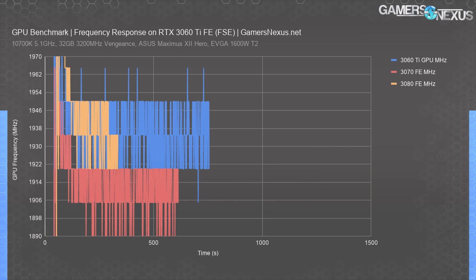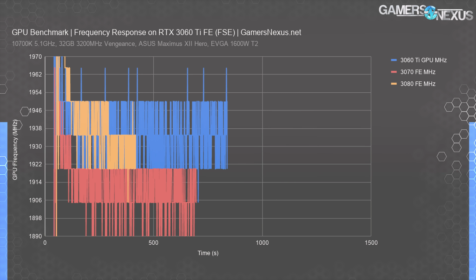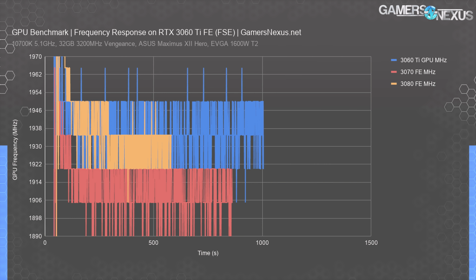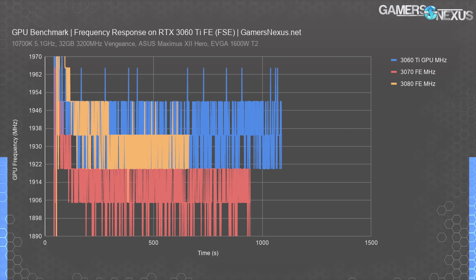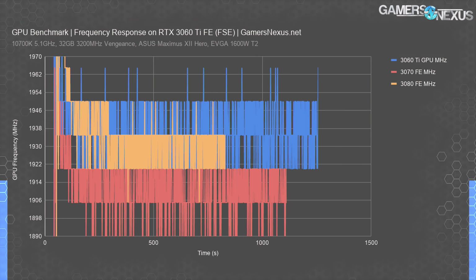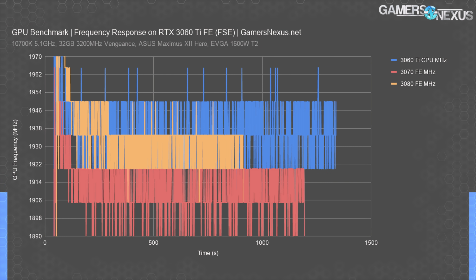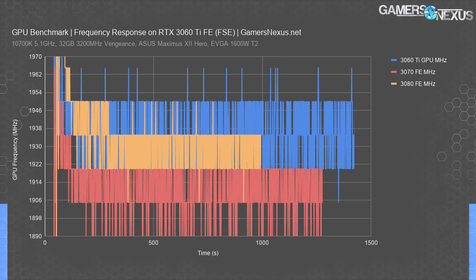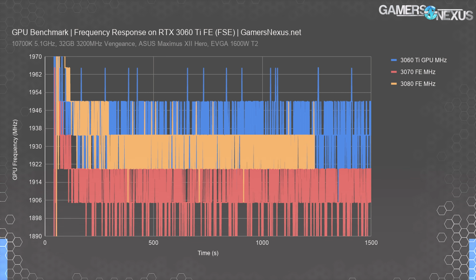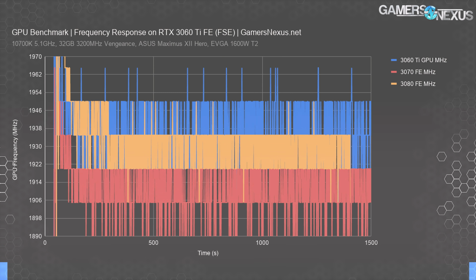This is somewhat expected behavior at this point, where lower-end NVIDIA GPUs often have very minor clock advantages over their immediate next larger-sized die counterpart. But they drop hardware-level improvements in exchange for that by nature of going to a smaller die size. The net result is that clearly a 3060 Ti will still be worse than the other two in terms of raw performance, but it's able to take advantage of improved stability at higher clocks due to reduced hardware complexity and close a bit of the gap, as far as it can anyway, without increasing the GPU complexity or SKU.